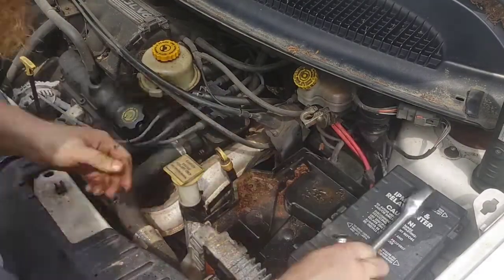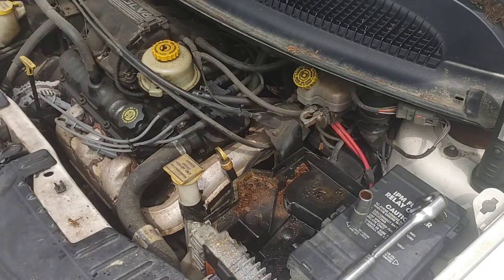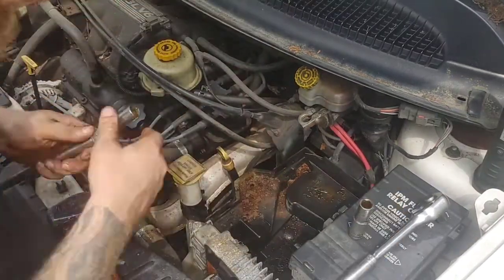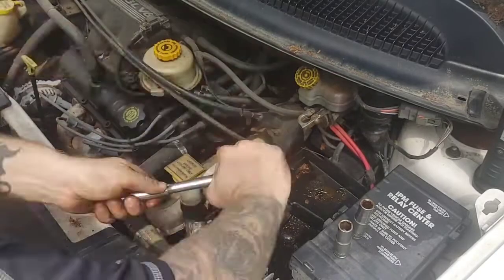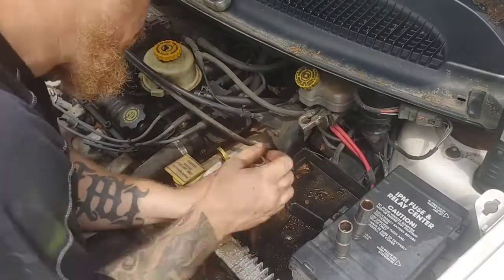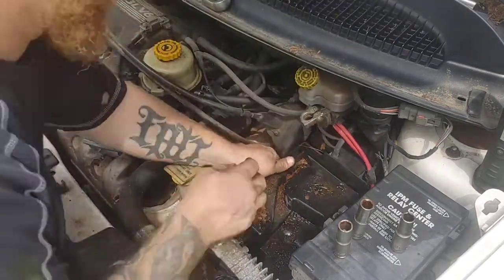As you'll see in the video, if you do have to do that, guys, remember, there are a couple key points when you have a corroded bolt. One, do not use a 12-point socket. That will only strip out the bolt further. Make sure the socket is a 6-point socket. Do not try to use an open or closed end wrench. It will not work. You have to use a 6-point socket. If the 6-point socket does not work after you pop it on with a little sledge so it has a nice tight grip, then you will have to look at extractor sockets, because a stripped out bolt or nut is just terrible to fight with.